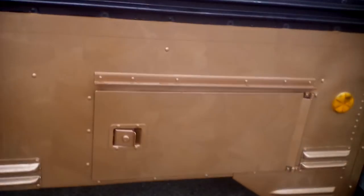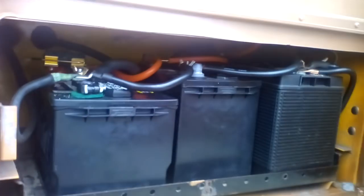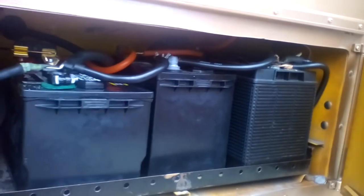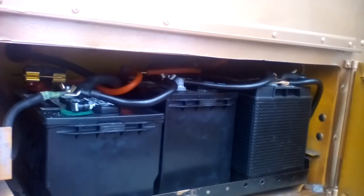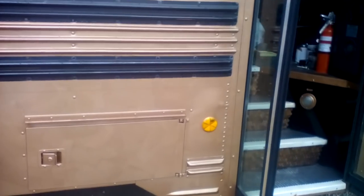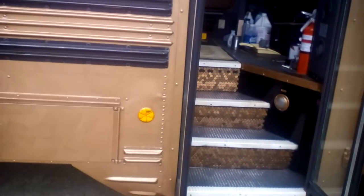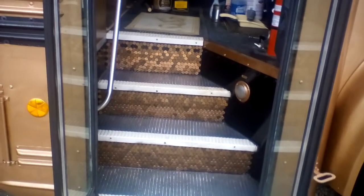We installed 2 extra batteries into the bus. Put a knife switch on the last battery, and therefore when we're parked, we can hit the knife switch and run the bus on electricity. Put in a 2,000 watt inverter. It's more inverter than what we really need or what we're going to use, but if we upgrade to solar and so forth later, at least we don't have to upgrade our inverter also.